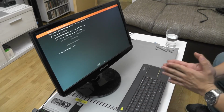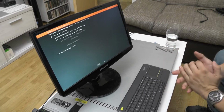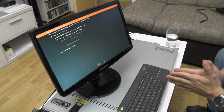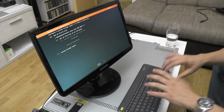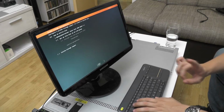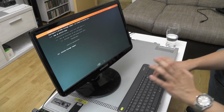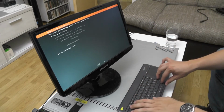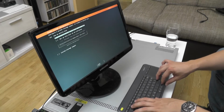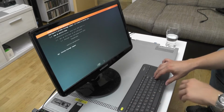With regards to partitioning, we are going to do something special here. We'll set up software RAID 5 since the controller doesn't support RAID 5. So this is an interesting option. We cannot use the pre-configured setting offered here because it lets us use only one of the 4 drives, and this doesn't work for us. We would need to use the custom storage layout.